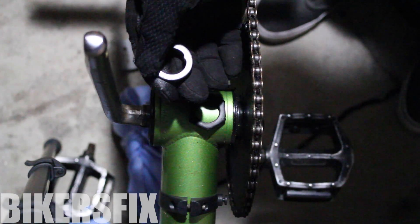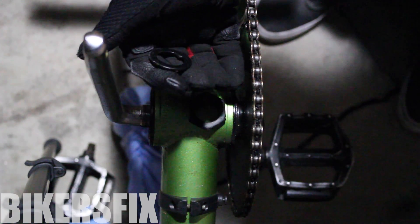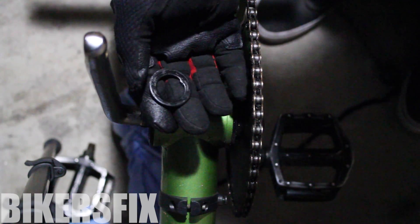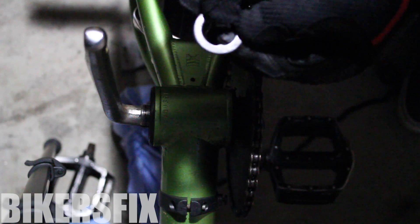You can see that the inside of the lock washer isn't completely round. There is a hump right here, and what this is for is on your one-piece cranks there is a place this little hump slides into. When you tighten the lock nut, the lock washer presses up against the bearing seal and it prevents it from loosening or tightening.